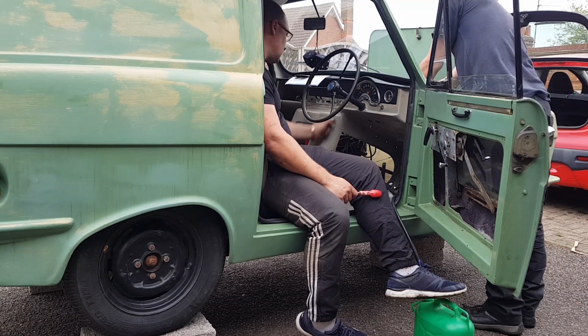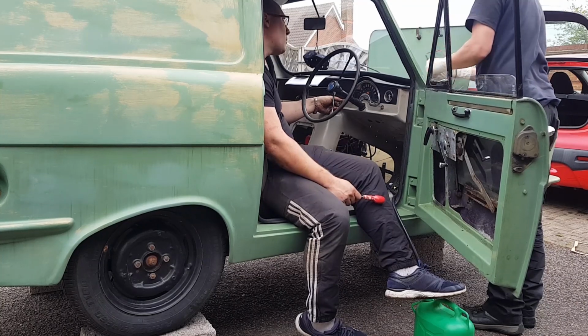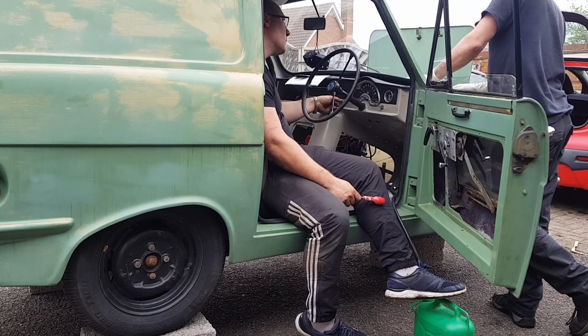Is the ignition on? Right, I'm getting volts on the coil, so crank it over. Because when you do something with that coil, it fires. Like when you join something up with that meter, it fires. Almost like it's getting power through the meter. You try it again.